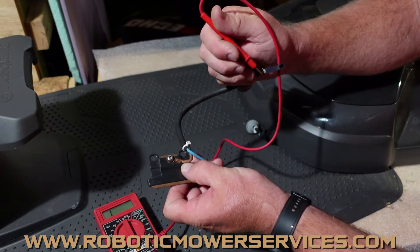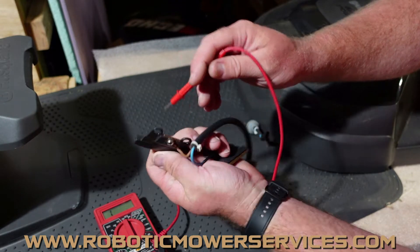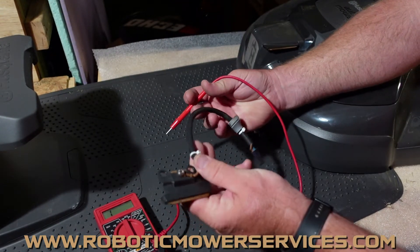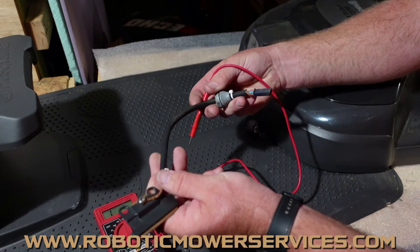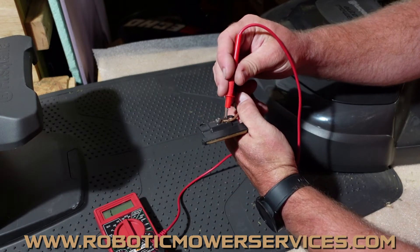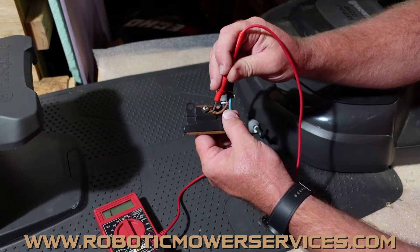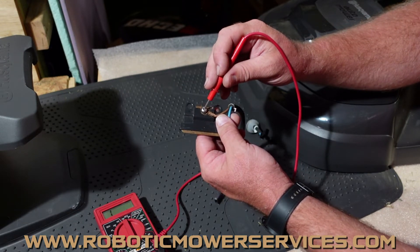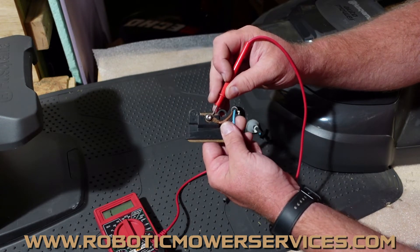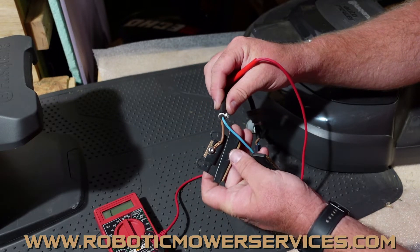And then from there, it would be from that pin to this plate — which is actually the same plate coming over here that this connects into. If you have good resistance — that one ohm or less from your connector up to this end of your wire where this terminal is crimped onto the wire — then what you'd want to do is take this screw out and clean up the terminal on this wire and clean up your plate and the screw, because that means there is moisture underneath, you've got some corrosion, and that just needs to be taken care of.